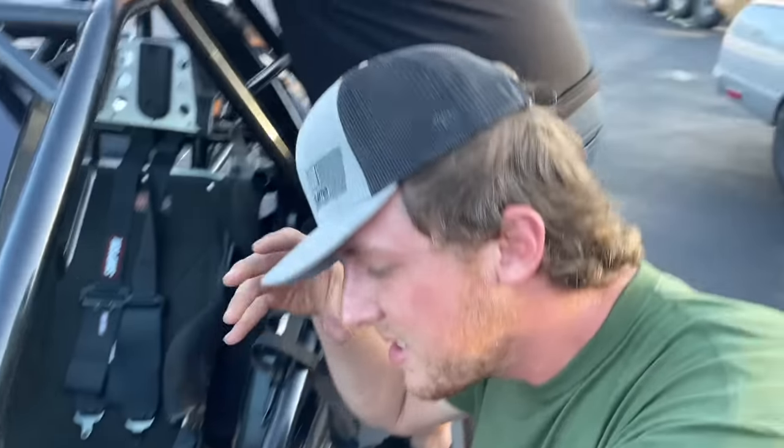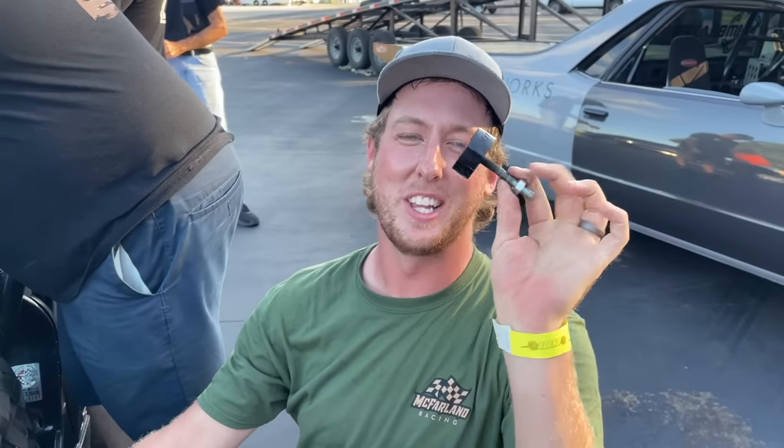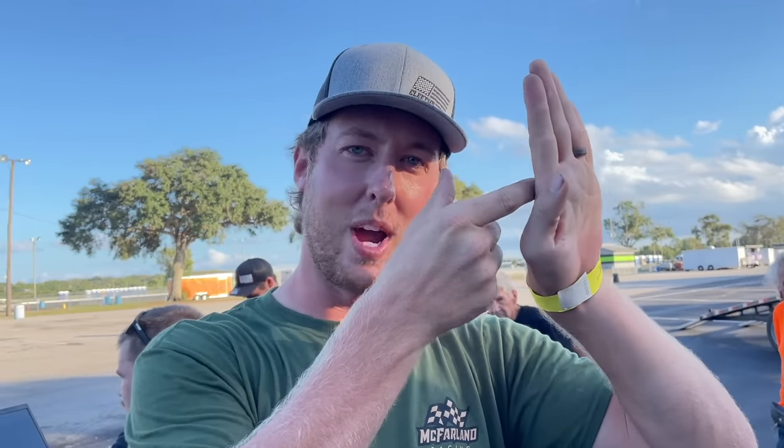What are you working on down there, bud? Getting the old clutch stop adjusted. We got a long one. This one, not long enough. Listen, here's a theory that I was taught today by the owner of the clutch company. He said, your pedal has a bunch of travel, but it only grabs down here. You need to reduce your pedal travel to right where the clutch grabs.